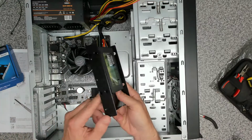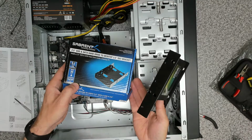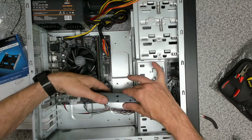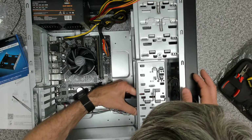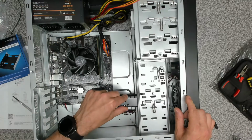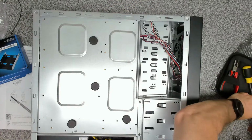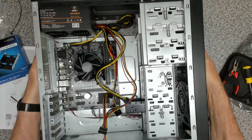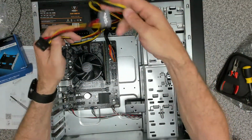Alright, so we've got the drive mounted in a cage. So this cage is just a 2.5 to 3.5 inch bay bracket from Sabrent. So we'll leave a link in the description for those. Really useful, and we use a lot of them. Okay, so now we're going to get this into here. Now the way this attaches, it's got just this little clip, so that just pushes down. You line up the holes, and then you lock it into place. Not the most sturdy, so we will put a couple of screws around the back. So 2 screws on the back side, and easy release on the front side, just holding that in place. It's nice and steady. Alright, so that is for our PCIe.